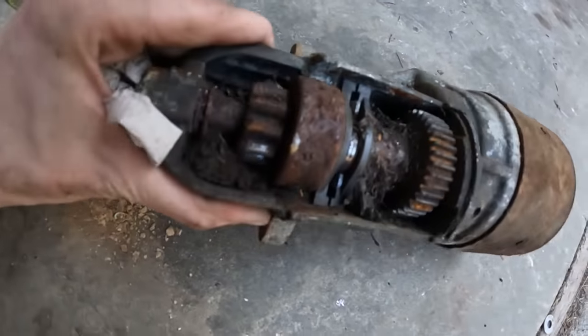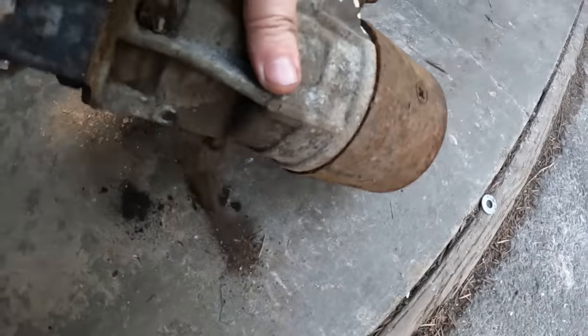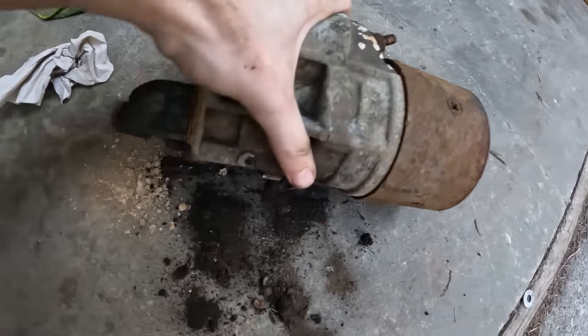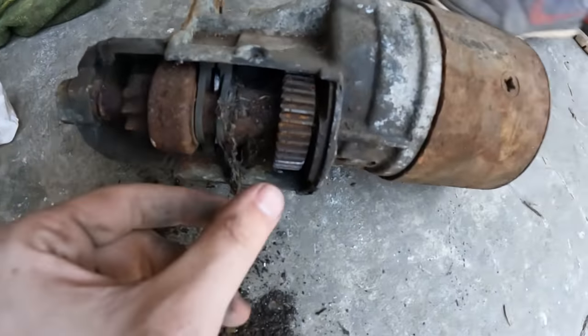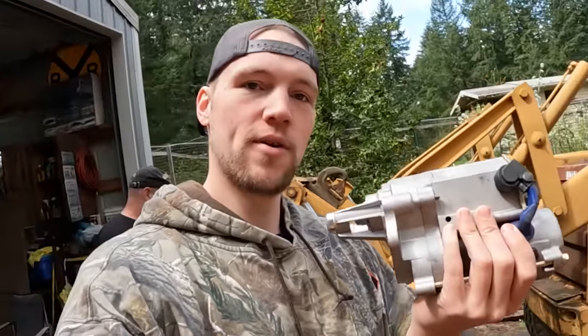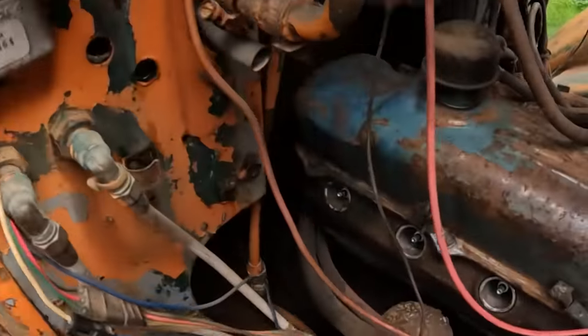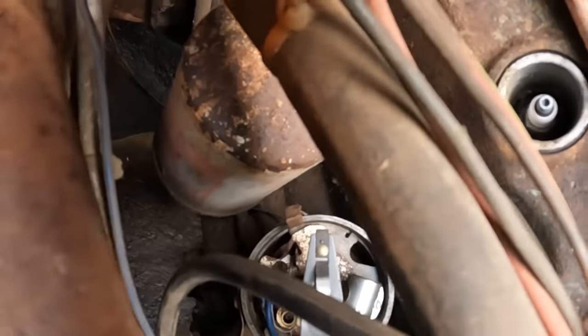He's cleaning out the carburetor right now - a whole bunch of gunk came out of it. The starter - this is only about half of what came out, a whole bunch dropped on my face underneath there. This thing was smashed up in there and stuck. Had to break out the old hammer and long screwdriver. The starter was completely rusted up solid - we put some penetrating oil on it but couldn't get it free, so we went ahead and got a new starter from the store. We also got some new points because the ones down there are absolutely fried.